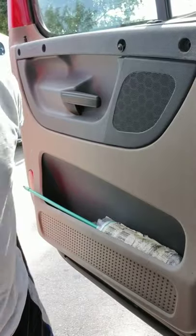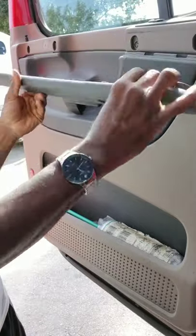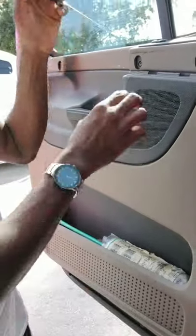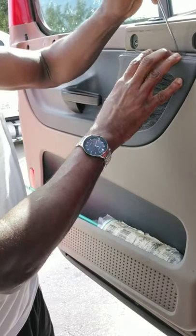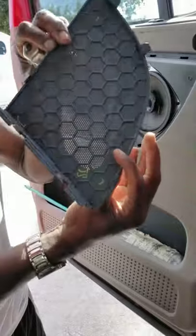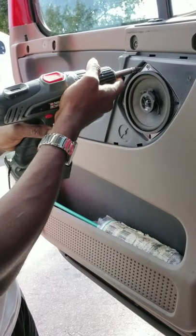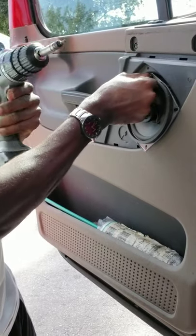Let's remove the panel. Here we go — screw moves and the panel comes up just as easy as that. Next we're gonna remove the covering for the speaker. You just press on the little grooves and it pops out, then remove it. And there you got that speaker — man, it's no good. Maybe it went bad because moisture fell into it. It's a T20 — T20 gets the speaker out.